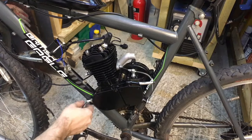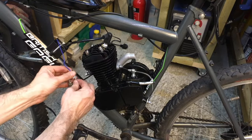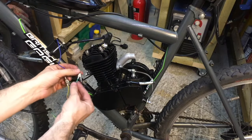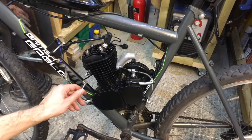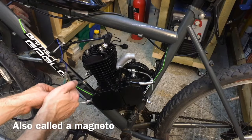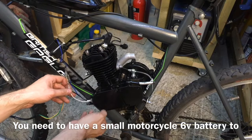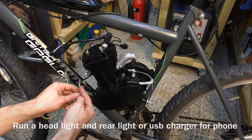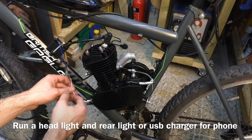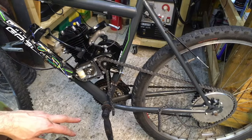The wiring is pretty simple. The wires from the engine - the black and the blue - just connect the blue to the ignition coil, the black there, and then the kill switch into those two sockets. There's a white wire left - the engine has a generator inside supplying voltage to the ignition coil, which creates a spark to ignite the fuel. The generator also has another tap giving 7.5 volts at 5 amps, which can be used for lights. You'll need a switch between those lights, otherwise there'll be a load on the engine when you try to start it.